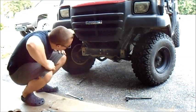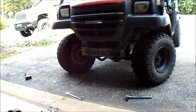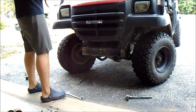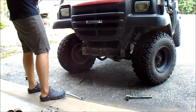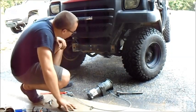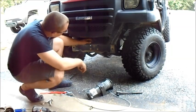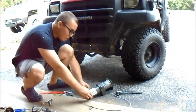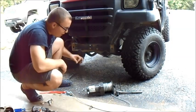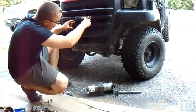We will see if I have enough room in here to mount up the winch, which is supposed to mount up in there. It's going to be freaking tight. I found a spot that will work to mount this up. I'm going to get everything wired up and run the wires down through behind the radiator here, then run the wires to the positive and negative. I'll run the bolts in — there are two little bolts right here that it's going to work perfectly for. Then I will have to run the rest of the wiring back to the battery. But first, I'm going to get this all mounted and get the wiring run from the bottom here.